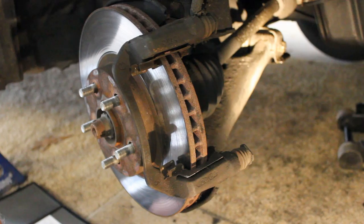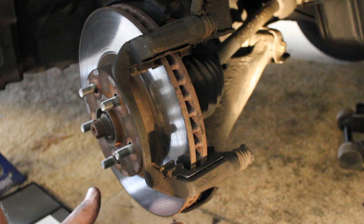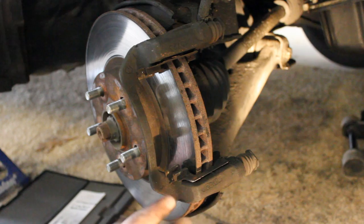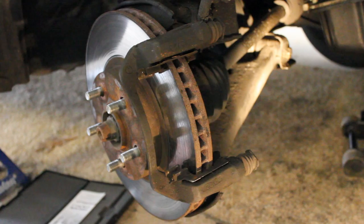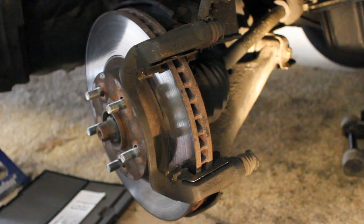We have now reached the most important segment of this video — please do not skip over this part. It's important for you to hear what I've got to say about rotors, and it's important to ensure that after you've done your brake repair your car will be safe to drive. We've got a few different options when it comes to dealing with your rotors. First, replacing the rotor: it is an absolute must to replace the rotor if its measurement is below the minimum thickness threshold. Whether you want or don't want to replace the rotor is up to you for affordability and comfort — but if it is below the minimum thickness threshold, you must replace the rotor.